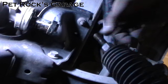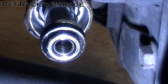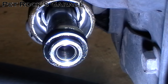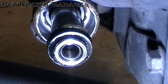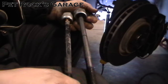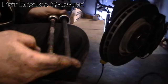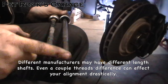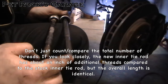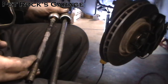We need to remove this nut so we can remove the bellows boot and transfer it over to the new inner tie rod. You want to clean out the threads inside the rack to make sure there's no debris, old Loctite, or anything like that that would prevent the new inner tie rod from screwing in all the way. Now compare your old to your new inner tie rod — specifically compare the length from the end to the flat on the back. If your new one is longer or shorter, adjust the number of turns when installing the outer tie rod to account for the difference. In my case they're the same length so I don't have to do any extra counting.